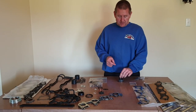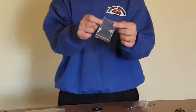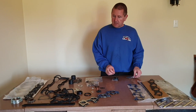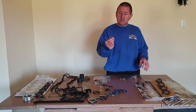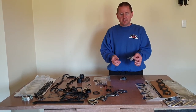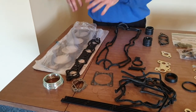I've popped one of those in. And in the bottom end, this little leaking o-ring — so common to leak — it's off the dipstick tube. For the few dollars it costs, it's well worth popping that in as well. Interestingly, this gasket set comes with the top o-rings for the injectors and the cushions, but it didn't come with the lower insulators. So I've popped a set of genuine lower injector insulators into the kit as well.